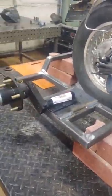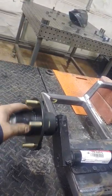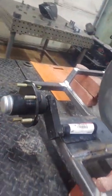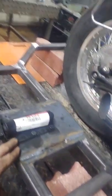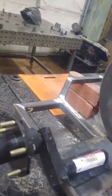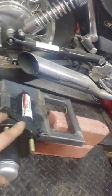These are torsion half axles — this is the suspension before the tires go on. These are independent; a torsion half axle has rubber inside. These are rated 425 pounds total between the two — 212.5 pounds resistance on each one. This does not let the bike lean; it simply goes up and down when you hit bumps, like a car. This is not a hard tail — if you hook a straight axle it would make it a hard tail, but the torsion axle will not allow it to lean. Just like a car, turning a curve quickly might cause some tilt, but it does not lean. You steer it — it is like a normal trike.